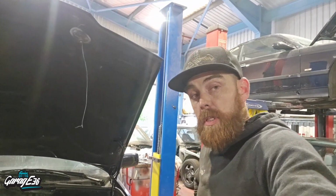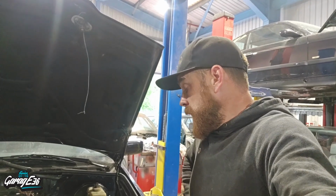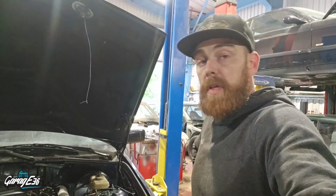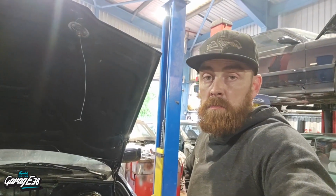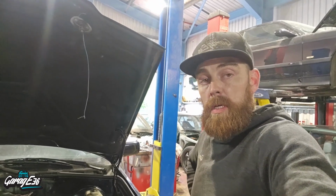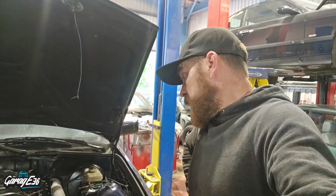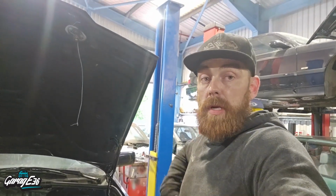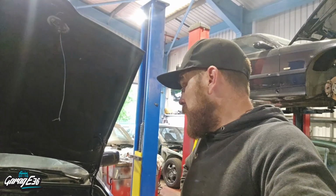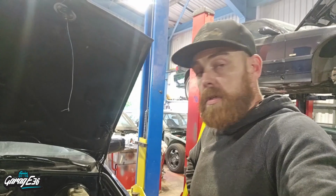Yeah, so this running issue is still not sorted. It's getting quite late today now, and it's Saturday, so I want to go home. I'll have another look at it in the week. As I said, I'll look into them injector leak off test results and see if they are out of the ordinary or not. As I said, maybe number 5 has quite a bit more than the rest, so that may point to number 5, so it might be worth looking at that. I can't be bothered to do it now. You have to take the inlet manifold off. It's quite a quick job. It's all on there at the moment. I want to be able to move it out here and just drive it on Monday morning when I come back in for work. Sorry, Tuesday morning, because it's a bank holiday.